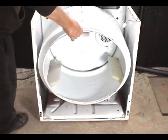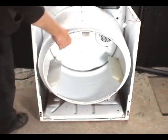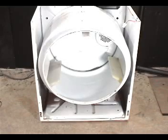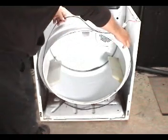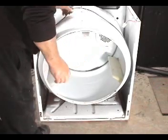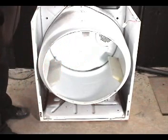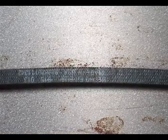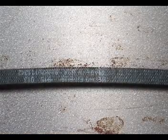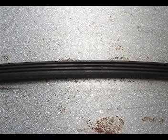As you can see, the coat hanger wire will hold the drum in place for you. Go ahead and place the belt around the drum — you could use the mark on the drum from the old belt as a reference. Make sure you put the belt around the drum like this and not like this; this is wrong.